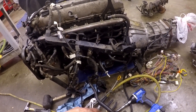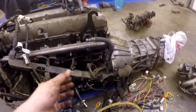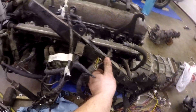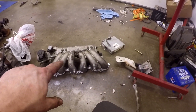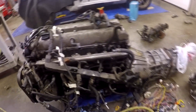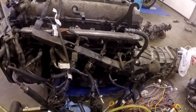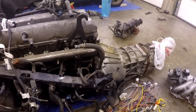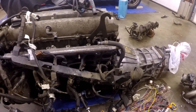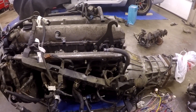That is really hard to do when you're by yourself, but I finally got the intake off. If you're not familiar with JZ motors, they have this big block where all the wires are — it's like their way of wire tucking, but all of these wires are bolted up in the middle of it so you can't really see them or get to them. Some of the wires are ran through the pipes, so even after you unscrew it you've got to feed the wires through. But here is the mess. That was a pain to do by myself, but now it should be pretty straightforward since everything is out in the open. I'm going to go ahead and see if I can take the wire harness off.